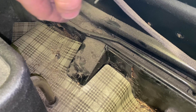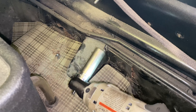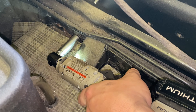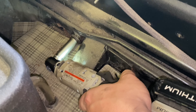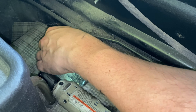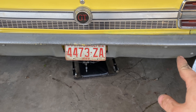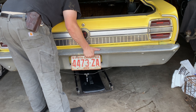Also, in my case I have air shocks, so I've got to disconnect this from that bumper too. Unless you have your setup like this, you don't have to worry about this step. But I have air shocks, so I'm gonna pull this nut here off so I can get this fitting out the back.